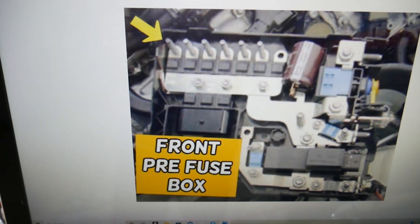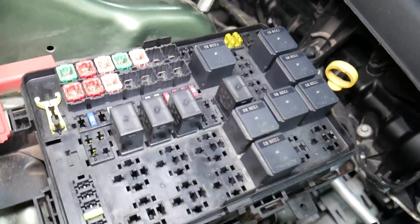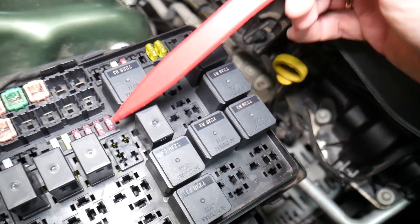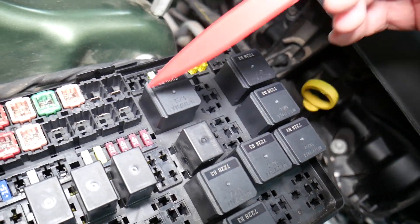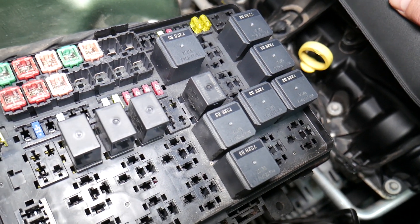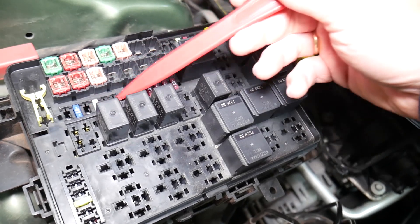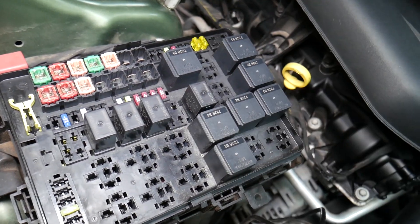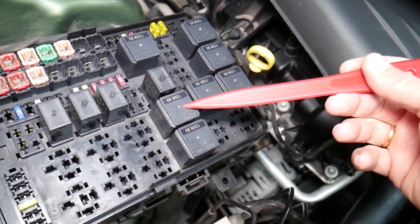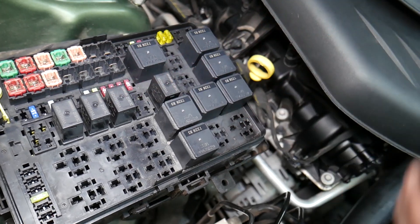Before we continue, let's explain quickly why it's always a good idea to test fuses and relays. It is super important to always test fuses and relays — and here's a common mistake people make. Sometimes you may think a fuse is good, or you cannot clearly see if it's burned. In that case, you may put the fuse back and end up spending money and time on parts you don't need, when all you have to do is just test the fuse. We'll put a link in the description below on how to test a fuse — it takes only a few seconds. The same thing for relays; some of those could be really expensive on cars, so we'll put a link below on how to test relays.